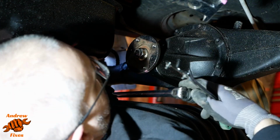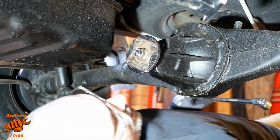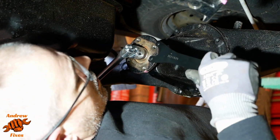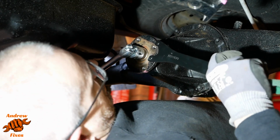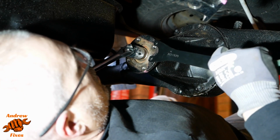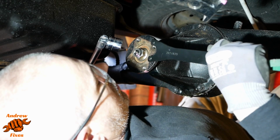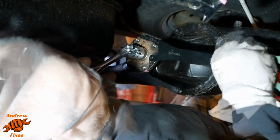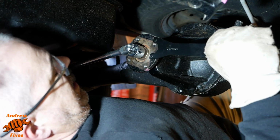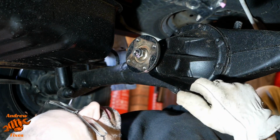And we're nearly there. Just going to see if I've got a slightly deeper socket. I do have a slightly deeper socket, which fits much better, but it's only on a 3/8, so let's see. I hope you can still see. Need to get myself into a good position here. Just a fraction more is needed. Okay, so 1, 2, 3 marks all in line.